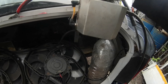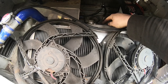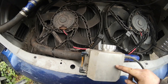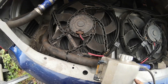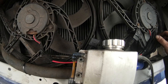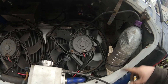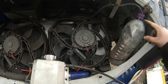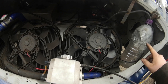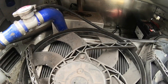This used to be the overflow bottle but it was just too small when we went to a rear radiator. Effectively, as the coolant gets hot, there's a little valve in the cap that opens and lets pressure out through these little lines. It then fills this up with the excess, and when it cools down there's another valve in the cap that opens under vacuum, and it used to pull the water back in. Now this bottle's not big enough to hold the amount of expansion the system creates. Brian Williams from Judd Power basically gave me the formula to know what size bottle you need - it worked out to about three litres. So this is my trial. I saw it on a post where David Goldstraw was struggling, which was lucky. If that works, David - make me a bottle like this that fits there and is three litres, please. Sort you some money out and we'll get that sorted.